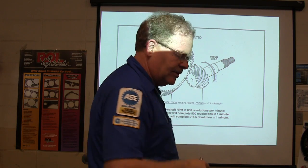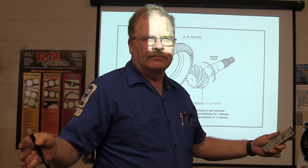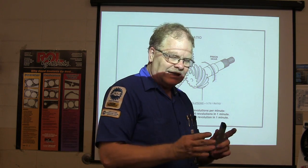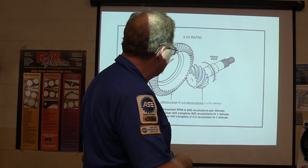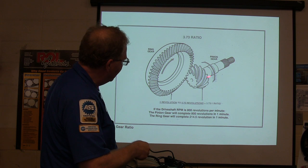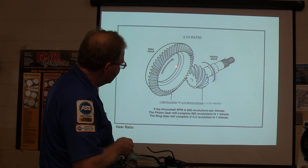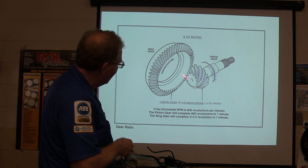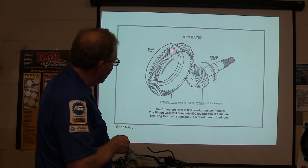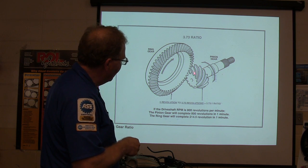Now, I'll tell you, one time I had to get a used rear axle housing for a Ford 78 F-350 that we had at the place I worked. And it was just like the other axle housing, but when I put the ring gear and the pinion in it, I couldn't get it to work. The pinion depth is important. There's a little shim you got to do to set that. And then basically the relationship between these two gears, the backlash and all, is going to be set by moving this gear farther that way or that way in mesh with this one. And when I pulled that thing together, I could not move this, no matter what shims I used on these bearings over here, I could not get that far enough away from that where that thing would work.